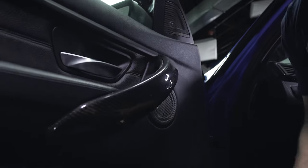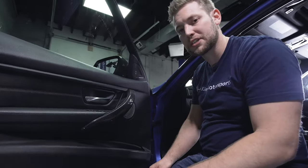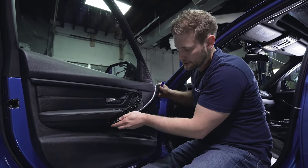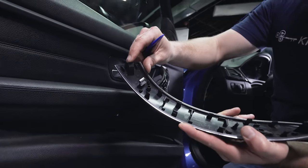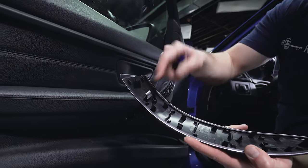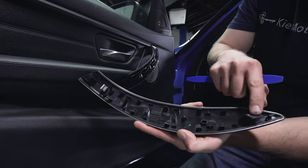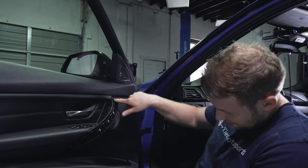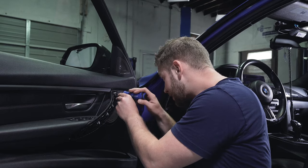My handle is going to come off a little bit easier than yours may because I've taken mine off probably like 100 times — full disclosure. Then pull it out through there. As you can see, there's a top clip that holds it in place. There's a series of clips which are supposed to stay on the door handle, and then there are little clips on the side and a big one down below. Then you need to remove the T20 screw here and the T20 screw down here.